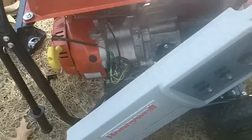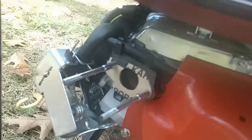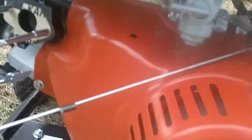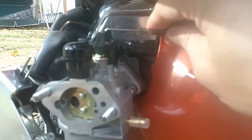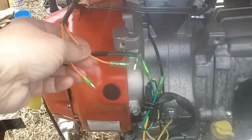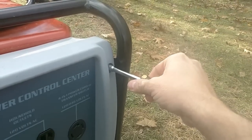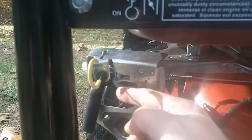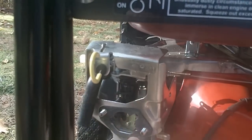We've dropped the side panel so we can get at the wiring for the solenoid. Here's the old carburetor on the ground. We've put on our new Caropac gasket, disconnected any linkages, and we're ready to install. We'll put the new carburetor on in place first before we do the wiring. Got the thing hooked up again on the linkage — this looks good. We're hooking up the solenoid — one's male, one's female, can't really mess it up. Then we're putting the side back on the power control. Put the four screws and the choke assembly back on — you just have to make sure that you put this linkage into the butterfly valve first, and then you can push it right on.